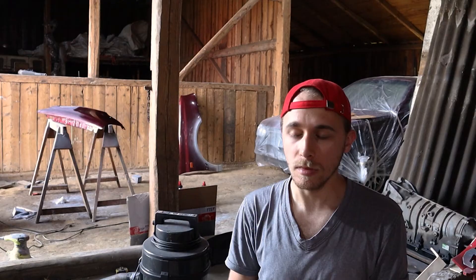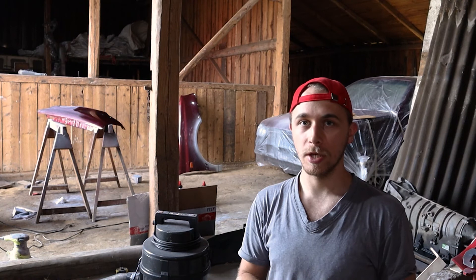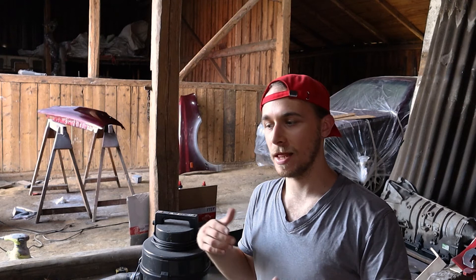I reprimed everything, then sanded the second primer again with 500 grit sandpaper — and that was my first mistake. When I laid the base coat over it and then the clear coat, you could see scratches from that 500 grit. I'd advise you to use 800 grit instead — the scratches are finer and it's still aggressive enough that the base coat will stick. Base coat should be laid really thin — it's the thinnest layer and it cannot fully dry before you start putting clear coat on, and you can't sand it.